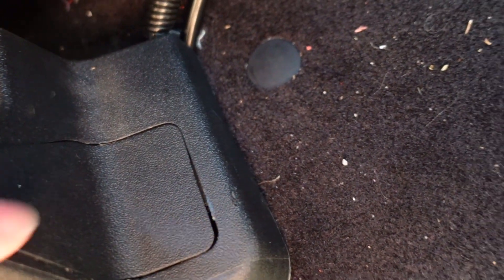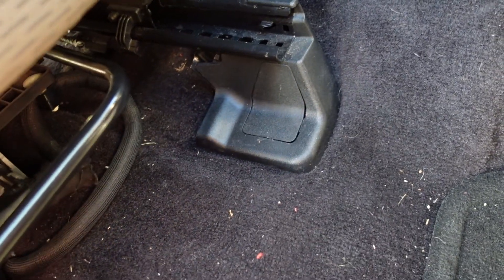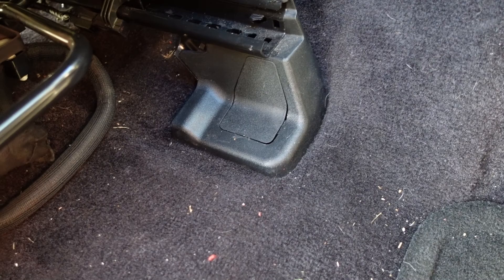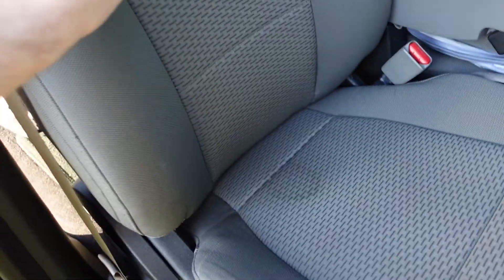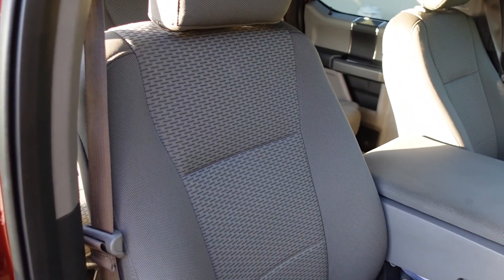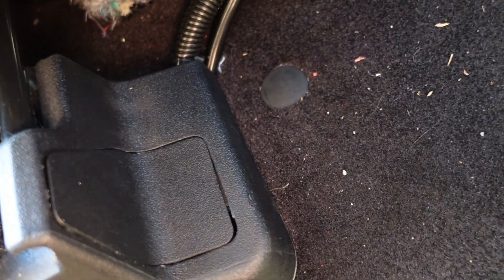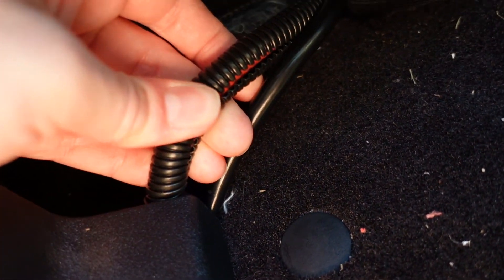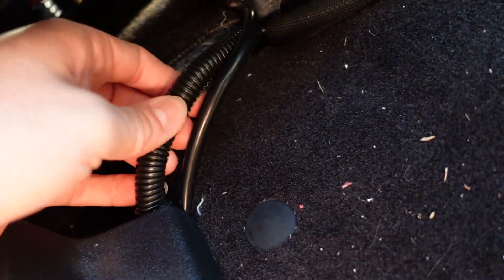It's going to come out from right under here in the cab. To take the seat out you're going to take these aesthetic plates off — there's two in the front and two in the rear. Underneath that you've got some half-inch bolts; go ahead and take those out. The whole seat can actually come out, but be careful — you've got some wiring harnesses you don't want to pull out. What worked well for me was to use the seat lever to lean the seat back appropriately, then pivot the seat and let the backrest lean onto the seat behind it. That kept it at a good angle so I didn't have to worry about removing the wiring harnesses and could still access to drill my hole. You can see we've got some more of that split loom — you can actually see the positive wire in there. I'm not going to wrap this one since it's inside; I've just got some zip ties at the ends to make sure it stays on nicely.